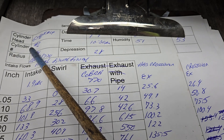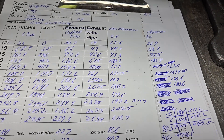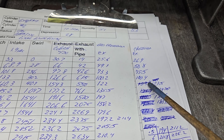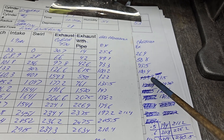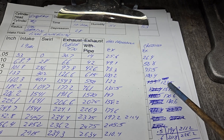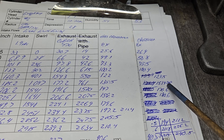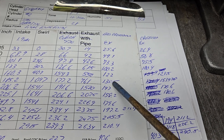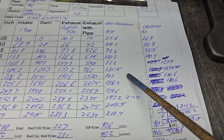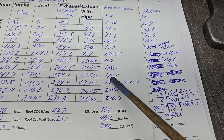For our exhaust flows we're going back to number two because it has an exhaust crossover, so we can look at both exhaust crossover ports. I did have a technical issue — that's why there's scribble here. I goofed up something and missed a lift point, so I had to redo it from 300 out, but we're pretty close side to side — 122, 121. Here we got a separation, really bad separation, and it sounded like it wasn't flowing well at all.